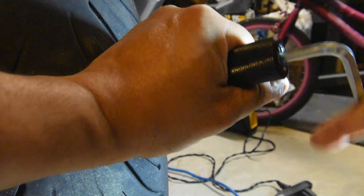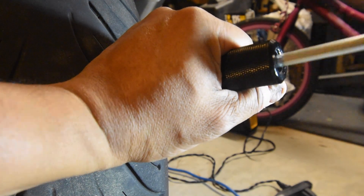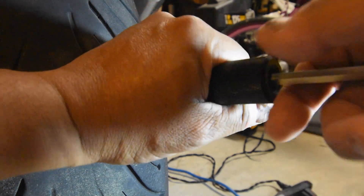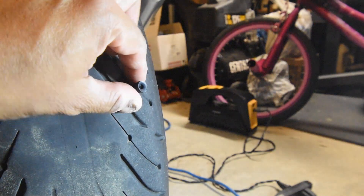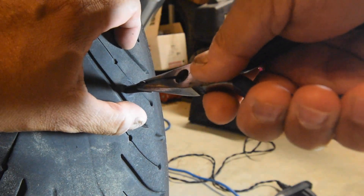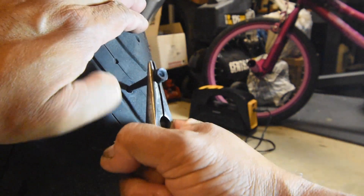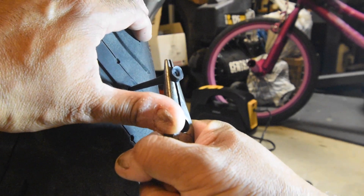It's all in there now, so now I just have to back this off like this until it's a good ways out, and then pull this out — and there we go, a plug. Now they say you've got to hold this with the pliers and pull it about two inches to seat the plug.